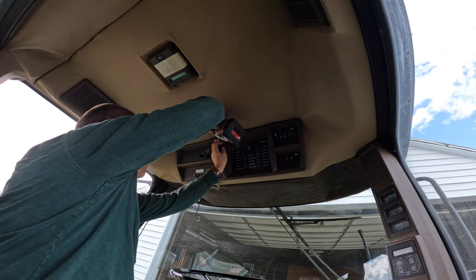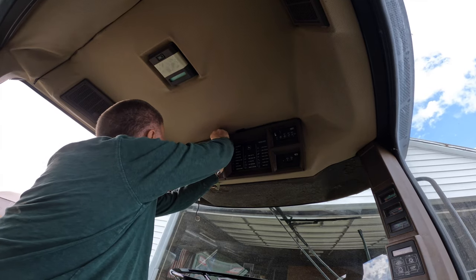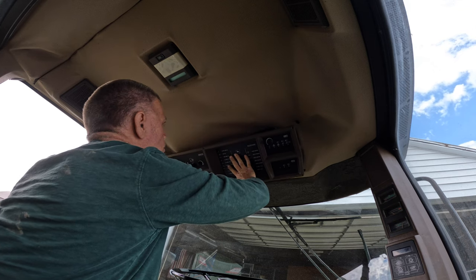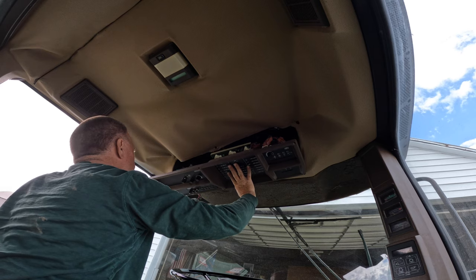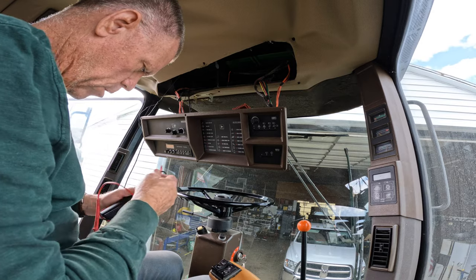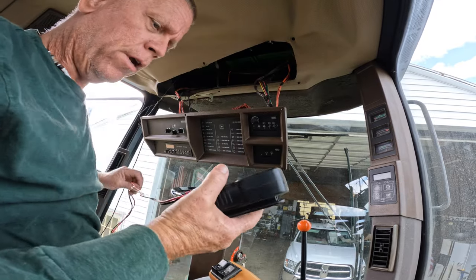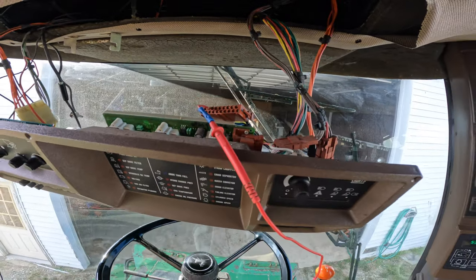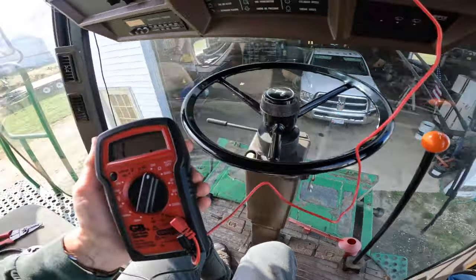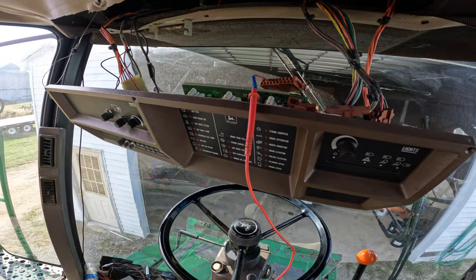Let me go back to the book and verify. I've got to check for continuity to frame ground. I'm not sure where I'm going to find a ground. I had to do some jerry-rigging to get this hooked up because I have to turn the key to the start position in order to test continuity, and I don't have enough hands to hold all these leads and turn the key.